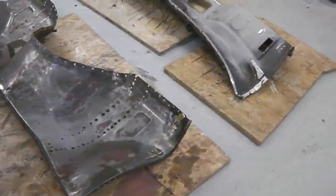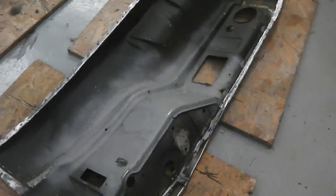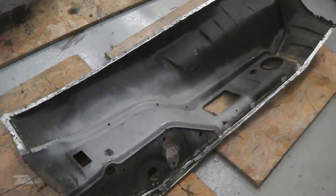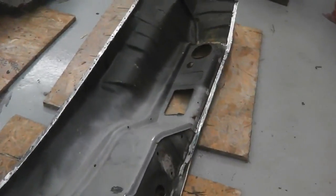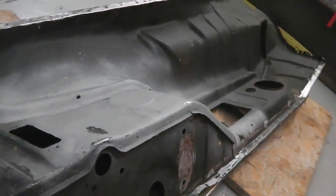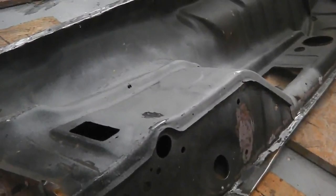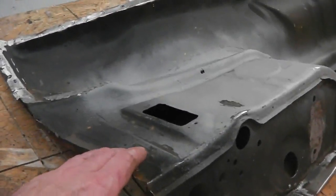Just up this side when we're doing that chassis repair, and the cold's going to go soon. I'm getting better now. So we were talking about getting the bulkhead fixed, and we talked about a donor bulkhead. Before your very eyes is the donor bulkhead extracted from the car, which took me quite a while to do. I was on it for at least a day to get this out. It's been MIG'd in.